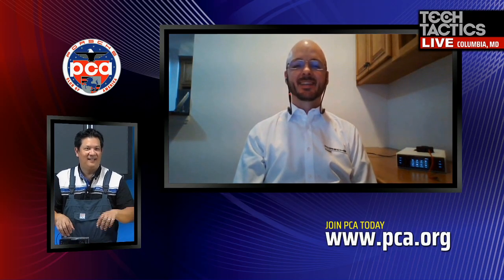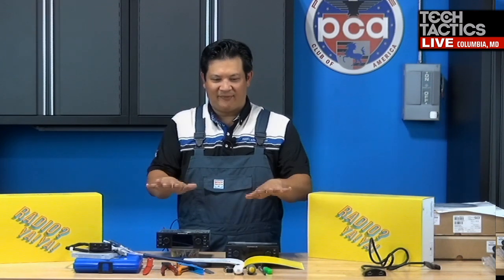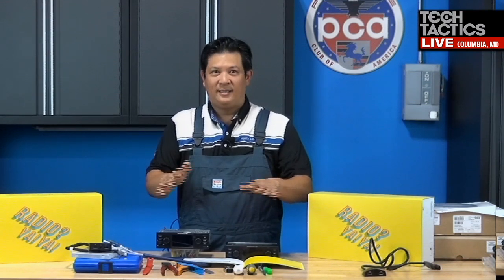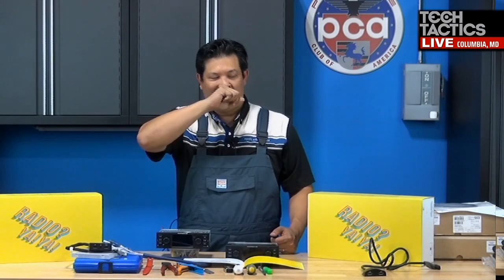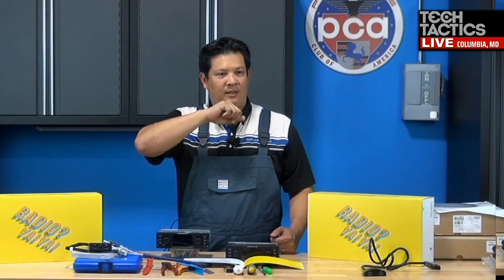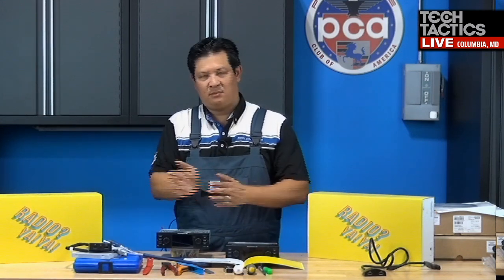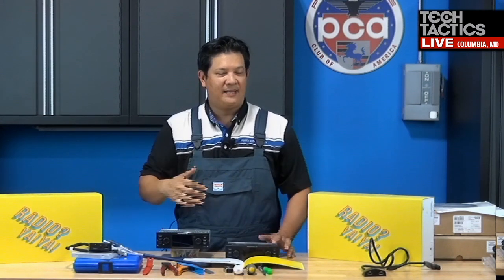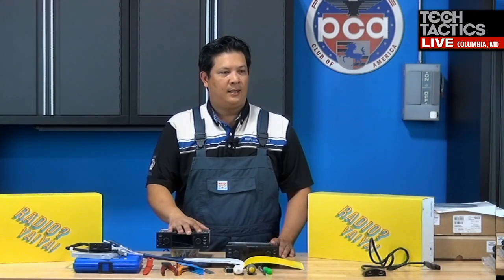All right. And so then running the microphone up above and tucking them. This car, unlike modern day cars, these G-body cars, other than the carpet kind of laying on top of the floorboard, it's really easy to run wires. I just ran down the backside of the bulkhead behind the dash and then down the center tunnel and just took a left to the passenger seat and connected all the radio wires there.